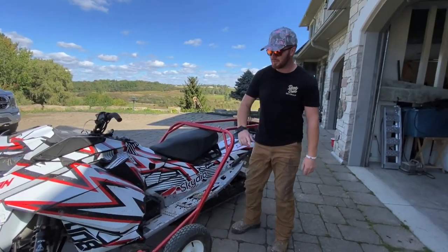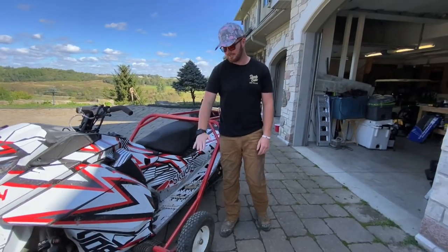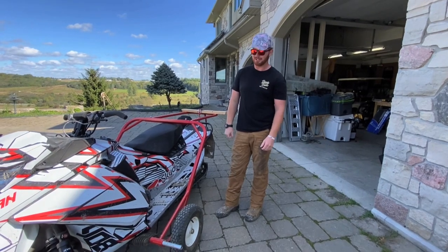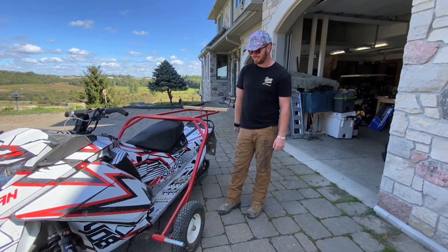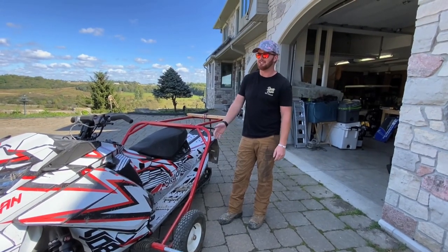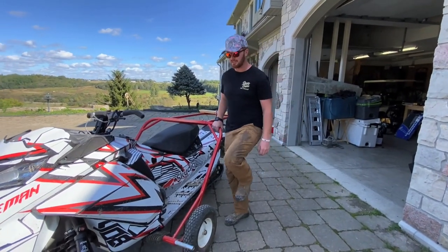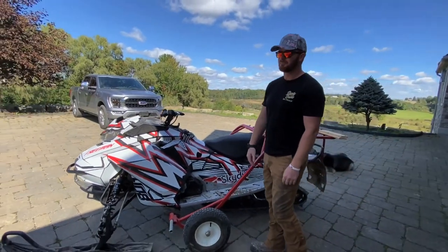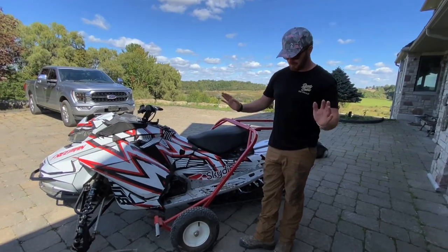And definitely number one thing is just cover up that belt hole, because that's your water plug on your boat right there. If you don't have that, there is a high risk of you going down. I used to skip a lot and I didn't really think about it for the longest time because on normal trail sleds, your foot goes right in there. This one doesn't, it's kind of just a flat wall. So first thing we did, covered it up and we were good to go.